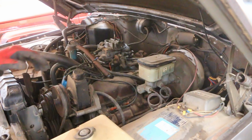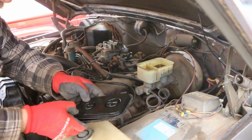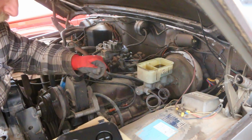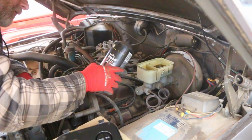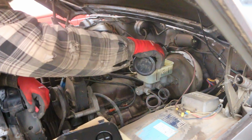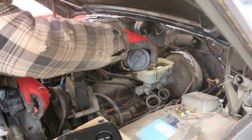before we get that far, this thing is just annoying. It's been bugging me. This cap has not been put down properly for the brake fluid, and the front reservoir is not dry, but it's close. Rear still has some in it, so we're going to take this probably expired brake fluid, and we're just going to fill it into the reservoir. That way, if there's any air bubbles, they can work out as we go.